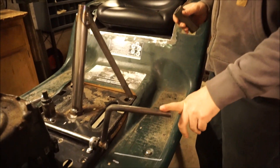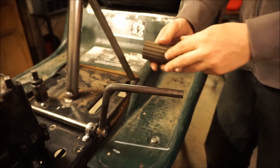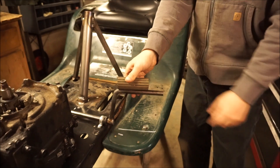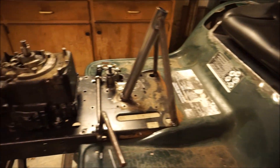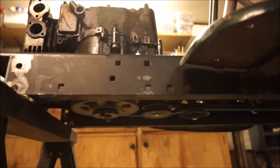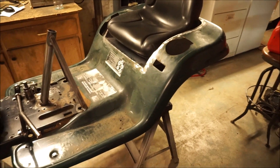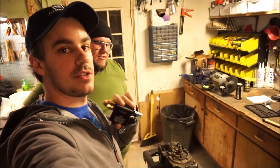One more thing — a little safety note — it's also in the rules: no protrusions, no sharp edges. I still have the stock clutch pedal covers from the Craftsmans; I'm going to slide them on as much as I can and cut any excess off the clutch pedal. You don't want anything sticking out that could injure yourself or anybody else. That blue belt under here is a Husky belt from Tractor Supply Company — Kevlar reinforced, I've had good luck with them. The only people that have sponsored these videos are Go Power Sports and they haven't even thought about contacting us. Next video we'll be doing MCP brakes on the mowers — setting up the master cylinder, pedals, all that stuff. Until then, we'll catch you guys with Janik Journal.